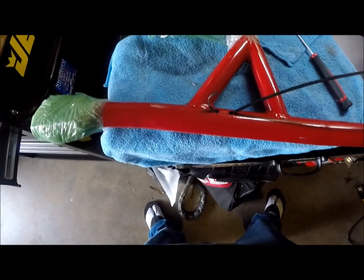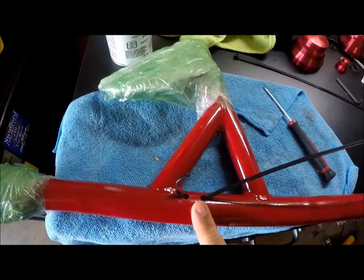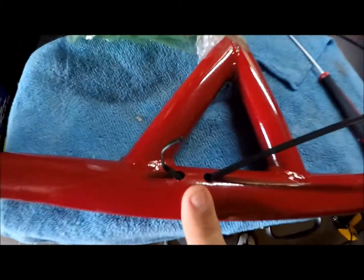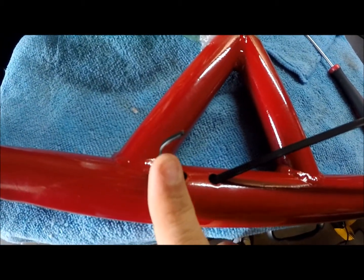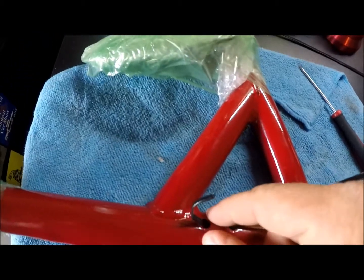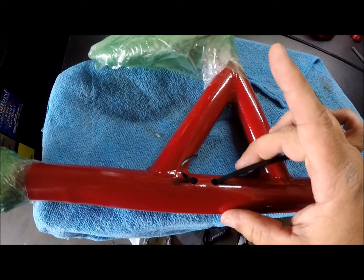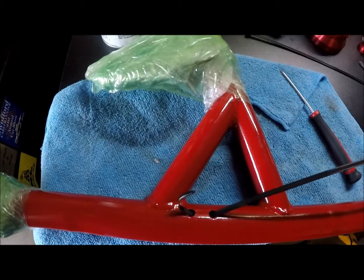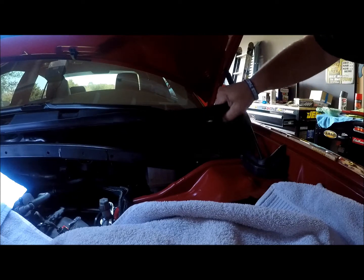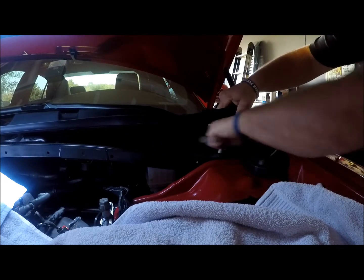So the plug on the ECM will not fit into this hole because it's obviously different. So what I have to do is zip tie it. Just bend it up at the end to get it through the 2 holes. Put a zip tie on here, and then we'll run another one through here around the ECM so it will be able to mount parallel with the bar up underneath. Shouldn't be able to see anything, with it being up under there. The 2 bolts on each side are 13mm bolts. So fix them up.